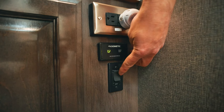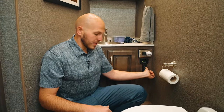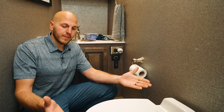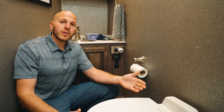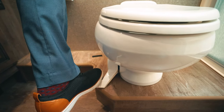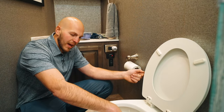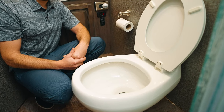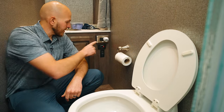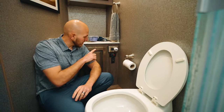For proper operation, we need the green light. On this particular model, we have the DVS-01 panel. Green means go, red means do not flush. You would energize your system and take care of your business. It doesn't matter if the toilet seat is up or down when you flush. If you are going to put solids into the system, pick up on the pedal, add water, then press and hold. This way we get a nice rim wall. Release the pedal and it should slam back up — we want that half ball to close very nicely.